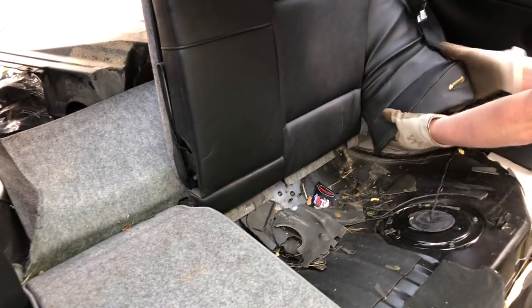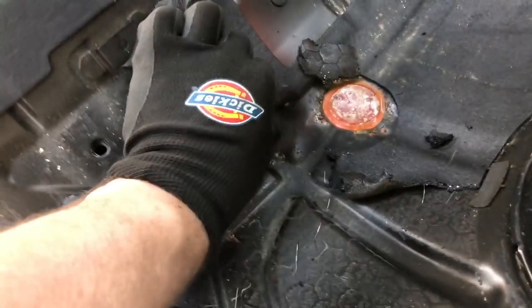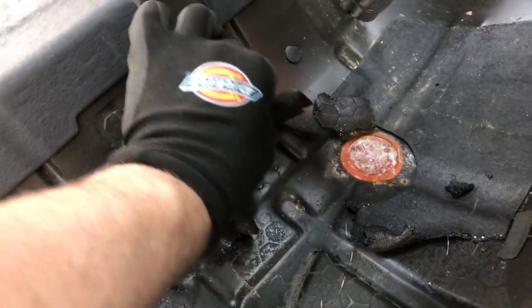After the engine was installed, we got to work fully stripping the interior. This takes longer than you think, and there are a lot of things to unbolt. The next step was to remove the sound deadening, as it actually weighs a fair amount, and this is where I was going to have to weld the roll bar in. We used a heat gun, and it came right up. You can also use dry ice and freeze it, and then smash it.